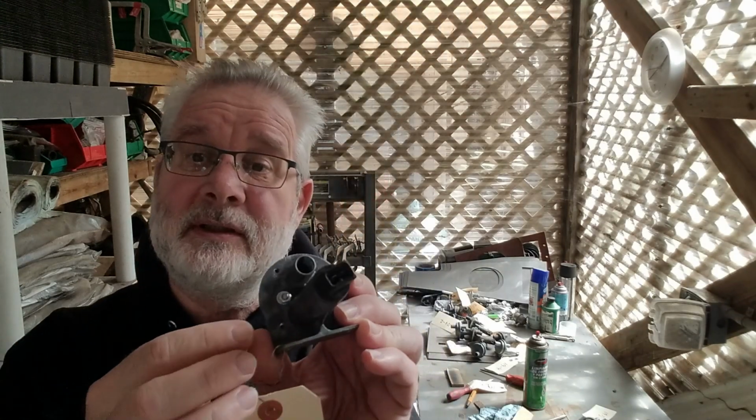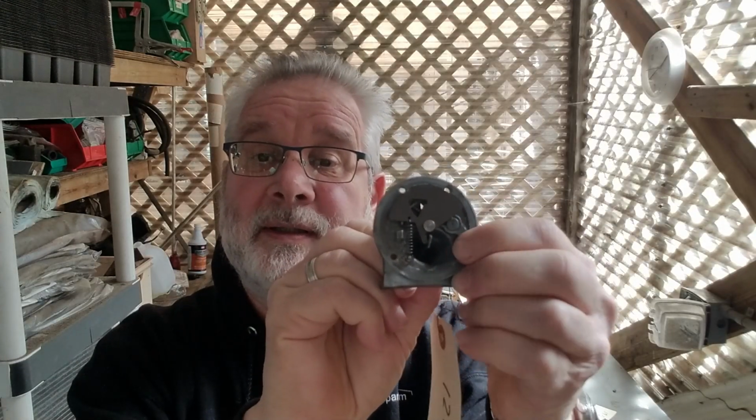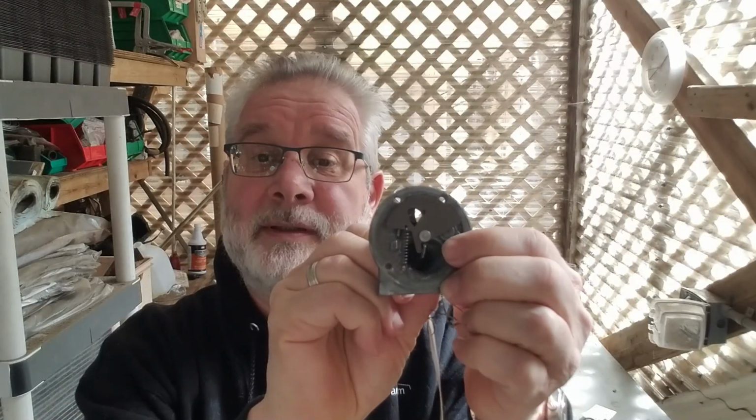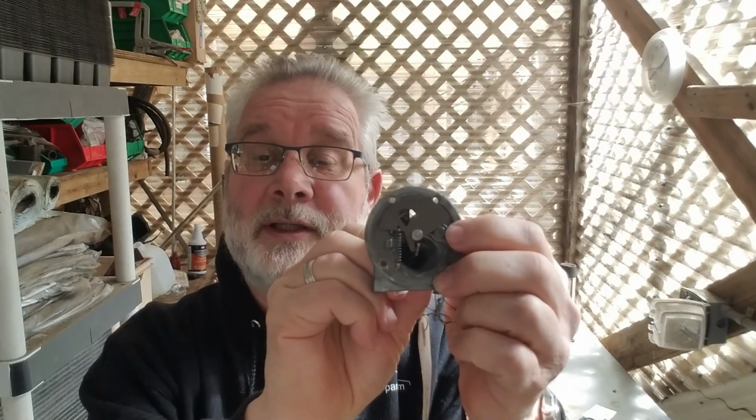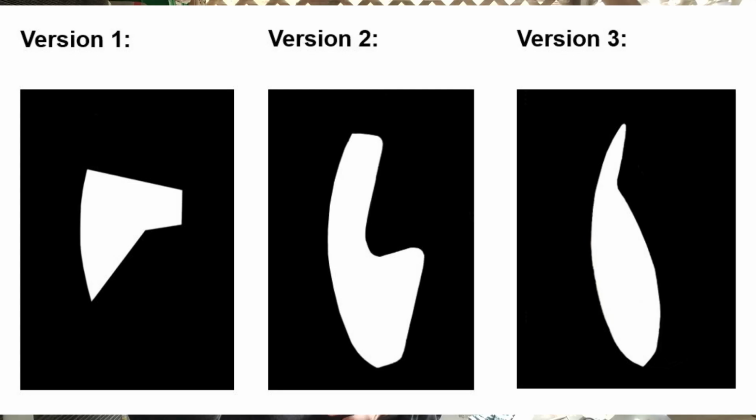If you have verified all that, you have your resistance and it closes, then you are in good shape and might get away with just adjusting the nut in the back. As you might remember from the other video, I'm talking about this nut here that you need to loosen, and then you can see the air gap here a bit, it will change the initial air gap. So if you are lucky, you can adjust it and tighten the nut in the back again, and then you're fine. That means if that gets you back to what I think is a specified air gap at room temperature, then you can just put it back in the car and the car should start.